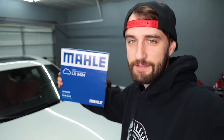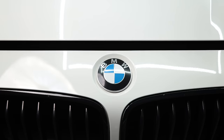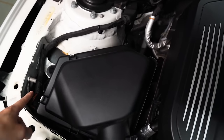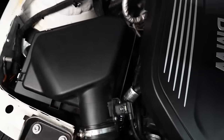Next let's knock out the engine air filter — it's super simple on the B58, so much easier than on my E90 with the N52. It's just a couple of clips that hold it in. Under the hood, there's your air box, and there are four clips that hold it on.